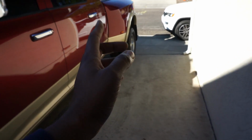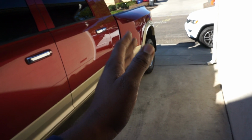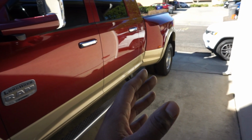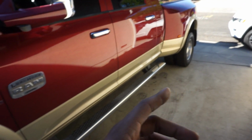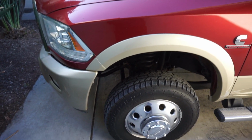And the rear is where I'll show more in depth, because if you never did rear rotors on a dually, it's a little different than a typical single axle, because you have to actually take the entire hub off and pull the axle shaft out. But have no fear, Cam is here, so we're gonna take care of that.